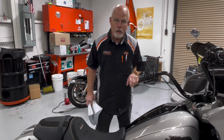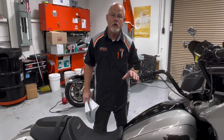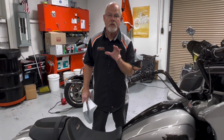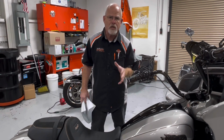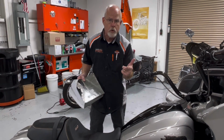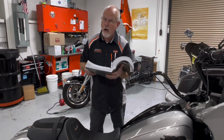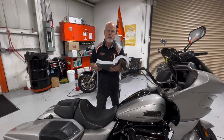I'm Doc Harley. Recently, I did a video on how to turn off most of your accessories, especially the heated grips, to make sure your battery has full potential when it's starting. And I got a lot of questions saying, well, doesn't the bike turn things off? So I did some research, and sure enough, the new models, the new Sportster, the new Pan America, and this new CVO have software that does turn off things. It's called the electrical load shedding software.